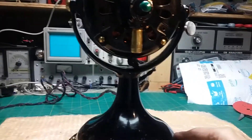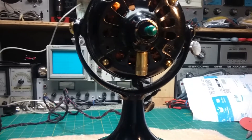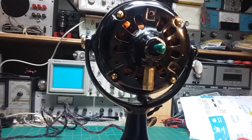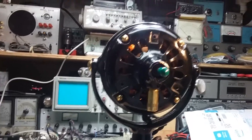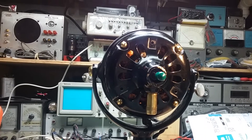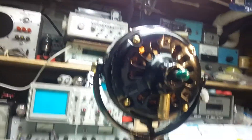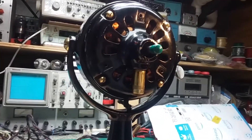That's because it was laying down. See, it's off now and it's been off for a little while — if we give it some power, it starts right up. I've been turning it on and off repeatedly and it's just when it's been laying on its side. The rotor in the bushings — it's a heavy motor with a very heavy rotor — just gets to a point where it doesn't want to turn. But after you give it a spin the first time, it runs fine every time.